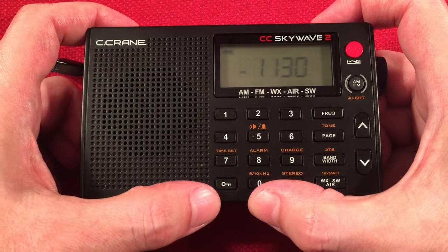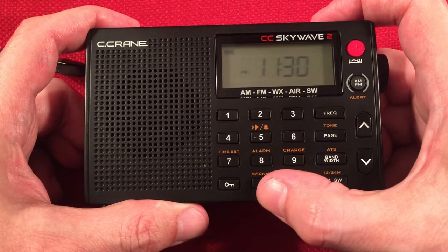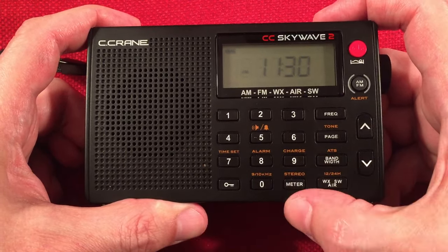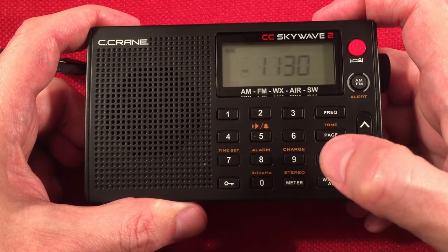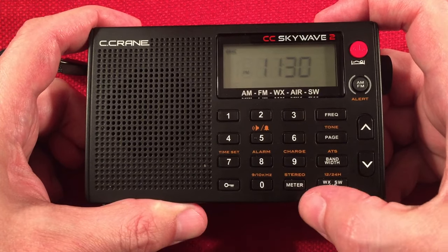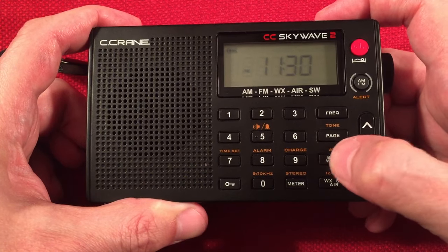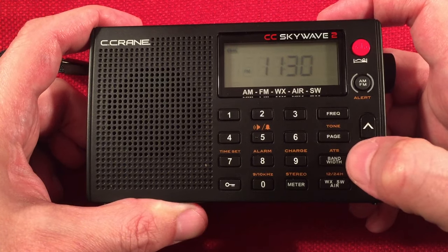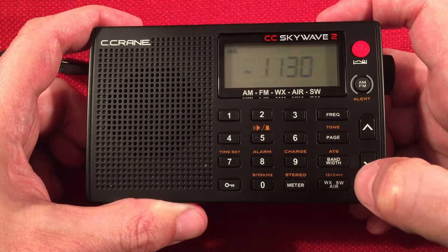Over here, you can see we got a lock button. Over here, we have the 9 kilohertz, 10 kilohertz mode. If you change it to 9, of course, you get the expanded FM band. Meter band takes you through those different meter bands it showed in the book. And of course, it toggles stereo on and off. That's important. Stereo off, you get better sensitivity for distant stations. And down here, we have bandwidth control. And you'll see that in action. Like the AM and shortwave, I believe there's 5 of them. You get 6 kilohertz, 4 kilohertz, 3 kilohertz, 2 kilohertz, and 1 kilohertz filters.